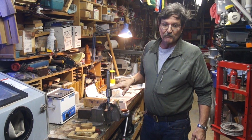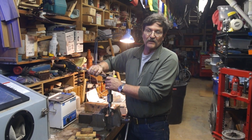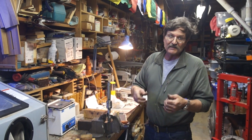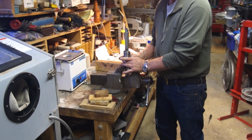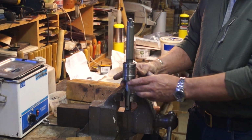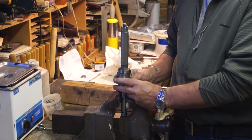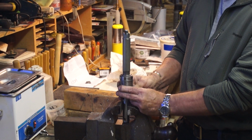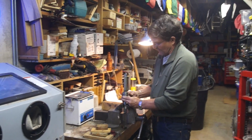So we have the wedding band where I think it should be. You put moderate pressure on it, basically the torque value that you put on your rear axle, which is not very much because the pinch bolt holds your axle. Now, my test is I take two thumbs and I put them against the inner spacer. With moderate pressure, if you really have to push on it, it's too tight. If it just slides over, like this, it's too loose. It's basically a judgment call. So I figure if it's moderate pressure and the stack slides, that preload is good enough. If you're going to err on anything, I'd say a little loose rather than a little tight. Okay, so I think that is where we want to be right there.